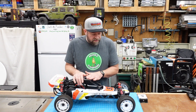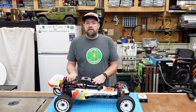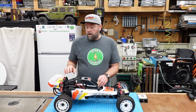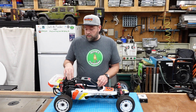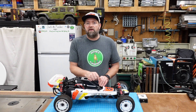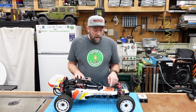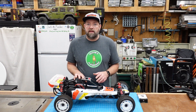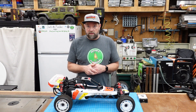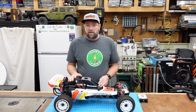Now we get into these high-end electric cars, and this one in particular with a fifth-scale size servo. The ESC does have a BEC circuit that delivers power to the receiver from the main battery and can power the servos as well. However, that BEC circuit in this particular speed controller is only good for 6 amps. Normally that would power any servo fine, but with fifth-scale stuff — especially this Reef's RC servo — it actually draws up to 11 amps at 8.4 volts. That gets into high voltage servos, and whether your receiver and other servos can handle high voltage.